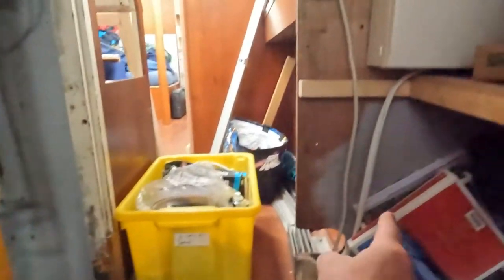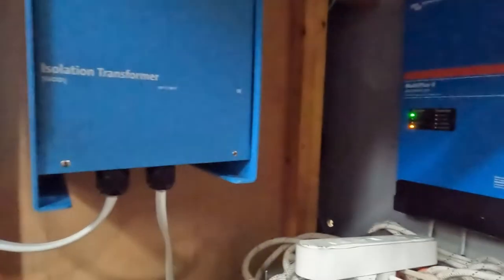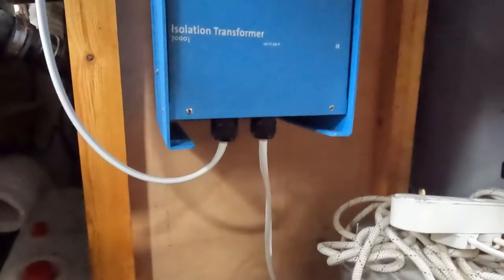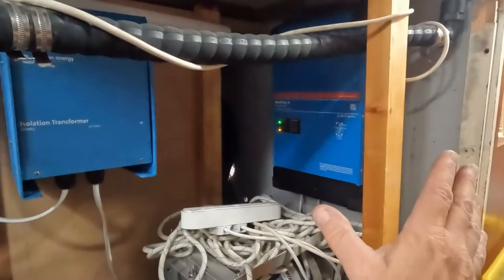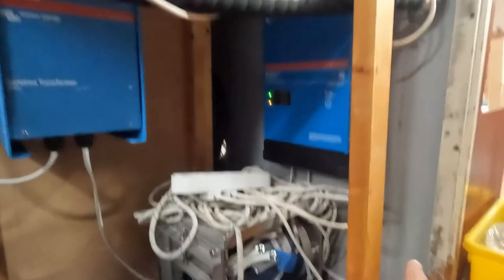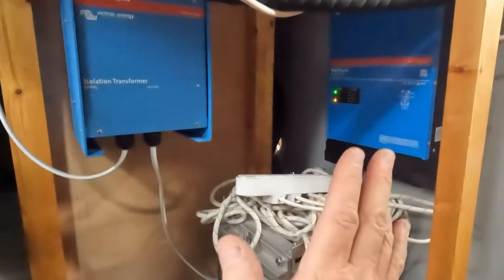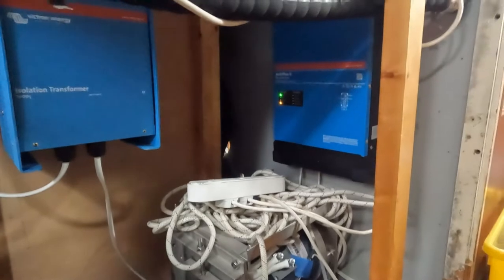From the MultiPlus 2 — this is slightly temporary — we go under the floor and we now have our consumer unit mounted here. All of this is using the correct tinned 4 millimeter cross-section cable. This side of the motor room side of the corridor will have all the switches accessible from the corridor side, so all the battery and master switches plus the circuit breakers will all be inset into this wall so everything's in one neat place.